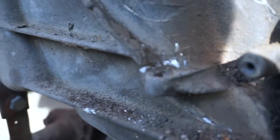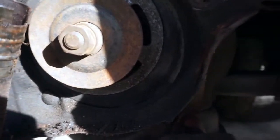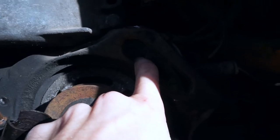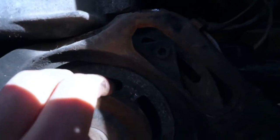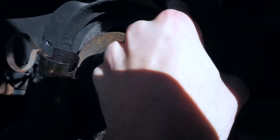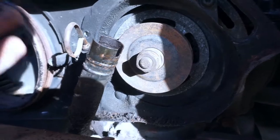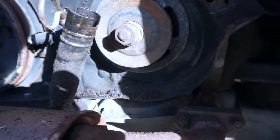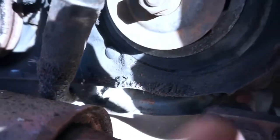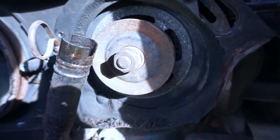When the back of the engine was hit from the impact, it actually pushed a piece of tin work right through the aluminum casing of the motor. Now I'm attempting to get the alternator out, which is proving rather difficult. I loosened it up with the tensioner bolt up here. I detensioned and removed the belt and the oil filler and all that stuff. I think I'm going to have to get underneath here with a wrench because I can tell there's a bolt right here — this is the head of which — and that holds the alternator in place.